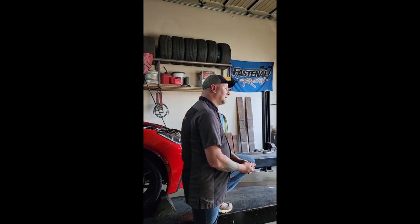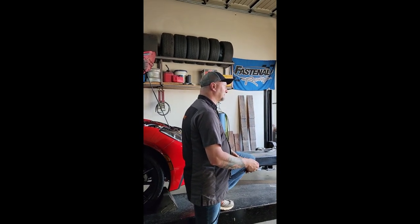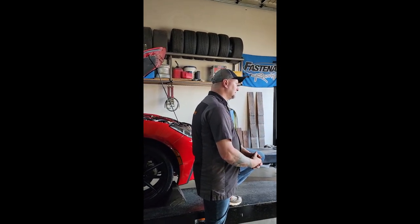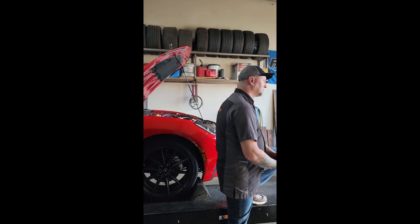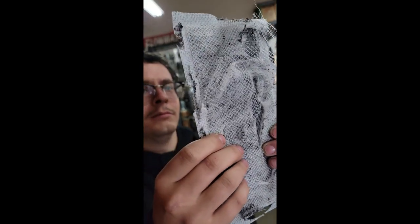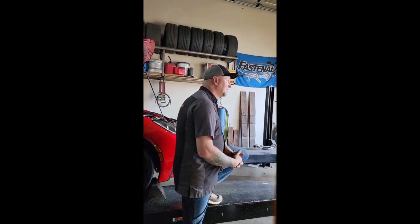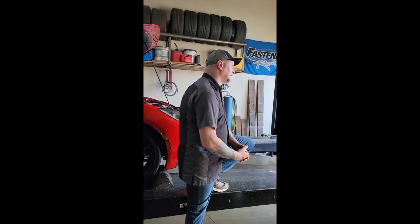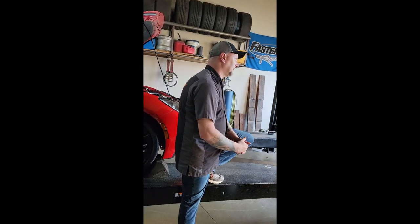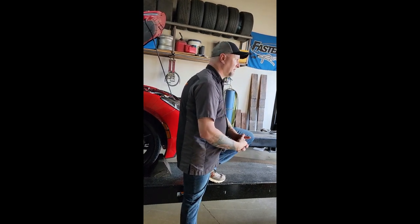I'm surprised. I'm actually really surprised, and it's a little overwhelming to see the results, because we're seeing somewhere in the neighborhood of about 15 horsepower on the top side of the curve. Go through looking at the dyno charts that we got posted in the video. And this is after we did all the testing, brought the car back. How to gain 20 horsepower. We got hot exhaust on it, we got hot air box. Sit here, tinking and clinking behind me after all the pulls we did. And pull for pull, back to back, we were able to show consistent gains by just cutting the glass mat out of your factory air box.